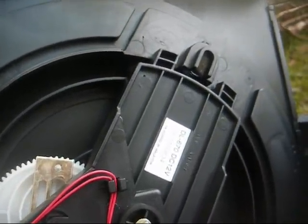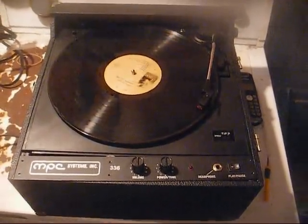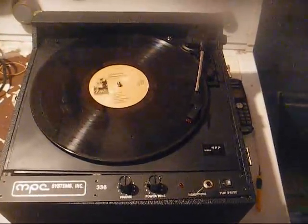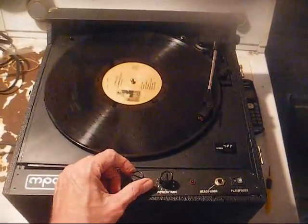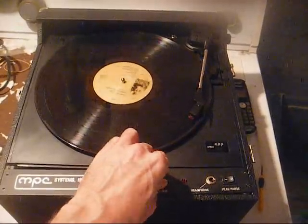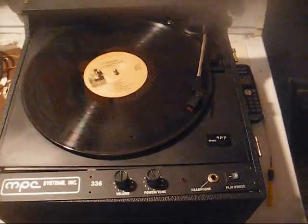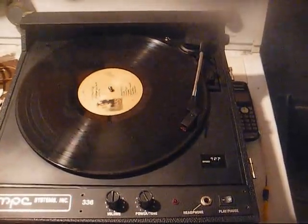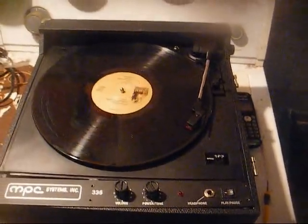Now I need to dig through my junk and try to find a belt that'll fit on this. I dug out a belt off of a Crosley Stack-O-Matic — it was a new belt that I ordered and then discovered the motor was bad, so I'm probably going to put a BSR changer in that particular record player. It works, but the volume's not very loud. It sounds okay, it's just not very loud. Now there's a gain pot on the amplifier, which we'll try adjusting. But these amplifiers are really designed for an 89T cartridge, which is a lot hotter than that Chuo Denshi cartridge.